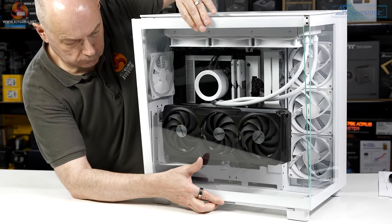On the cons side: it's a dual-chamber case with a very large footprint that requires plenty of desk space. The Q120 fans supplied are rather basic — DC controlled rather than PWM. And while there are radiator fan racks in the roof and side, there is none in the floor, making floor cooling installation slightly more work than it needs to be. Overall, the NZXT H9 Flow is a good case but not a great one, earning a 'worth considering' award.